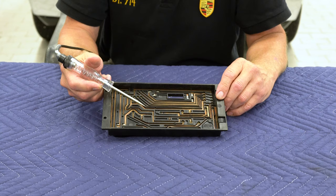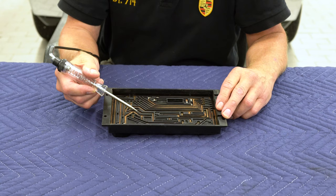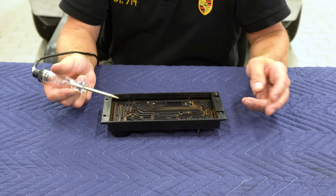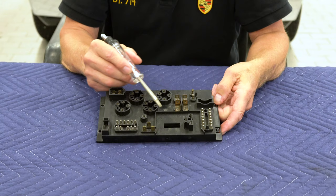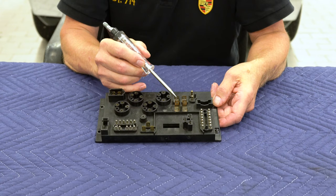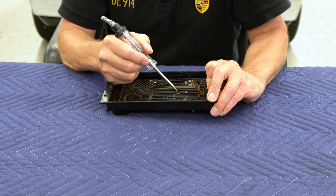This is the rudimentary integrated circuit. Once they plumbed it with copper, they covered it with non-conductive tar and then just soldered some joints. These rarely fail, so don't ever accuse the relay board of causing your 914 problem. We have many people send these in to us for rebuild — we clean it up, re-solder the circuits, coat it with new tar, put dielectric grease and contact oil, and make it conduct electricity well again. Usually what happens is somebody puts a fuse heavier than 25 amps in here, the fuel pump starts to draw too much energy, and that melts the terminal, so the relay board does go bad.